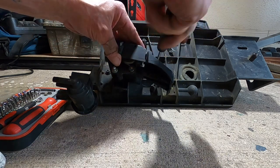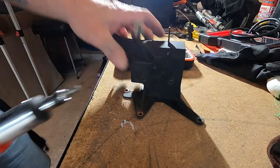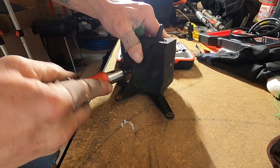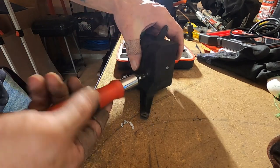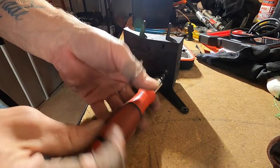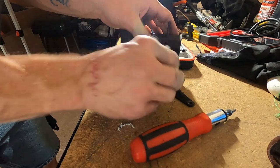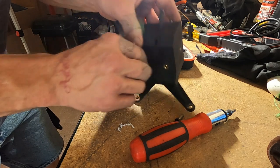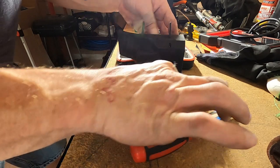Take this thing out here. Perfect, there it is, in hand. So here we go, man, it's a T25 Torx bit. Just break these loose. Wow, those are pretty tight too, they've been there for a while. There we go. Let me just back these out real quick. We should be able to pull that sensor out. Well, pretty quick. Then I'll show y'all the part number on this, this is an OEM original accelerator pedal positioning sensor. And then we'll finish this video.